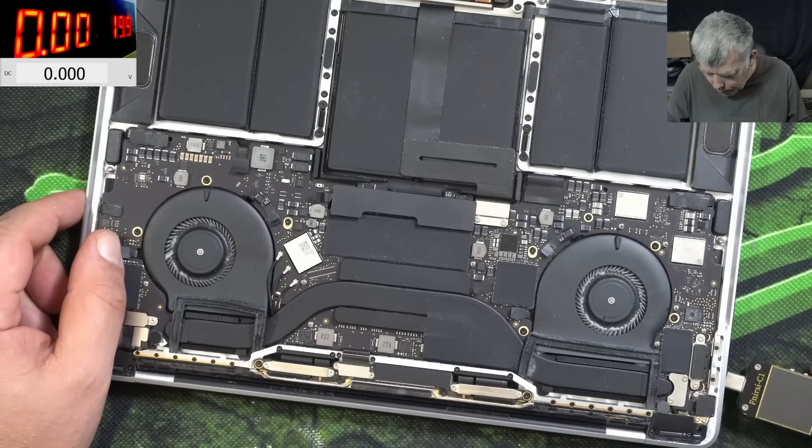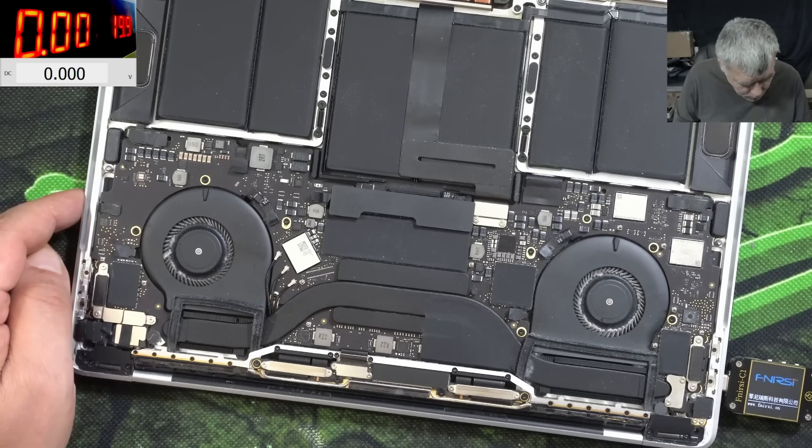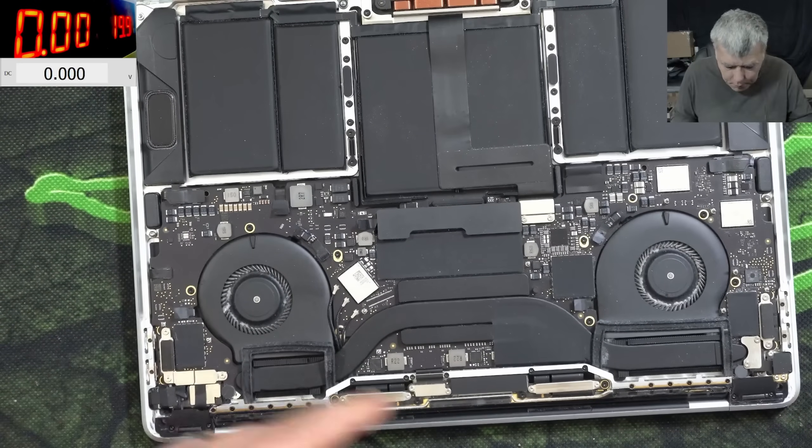Wait — this has four USB-C ports but we didn't check these ports. Same story: 5 volts. Let's go and check the main power rail, just to be sure it's not shorted. Let's see what voltage we have there — the battery still has some power.